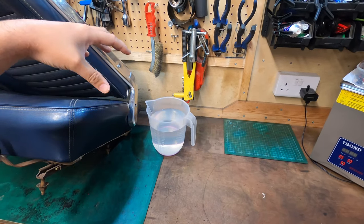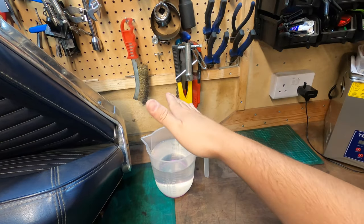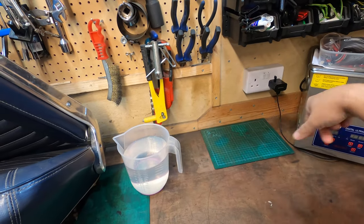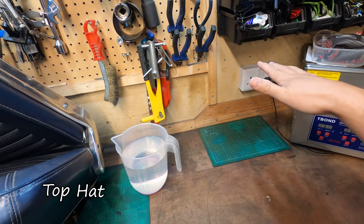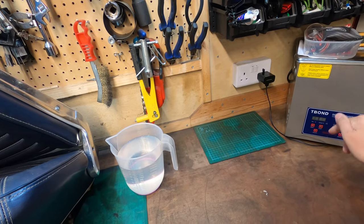So for those of you who are familiar with the Mustang, you have a cowl at the front and the cowl has a bucket at either side. Water will enter the cowl from the top. It should run down the cowl around the bucket because these buckets are only for air and drain out the side, down to the fender, to the ground.